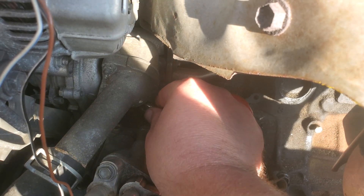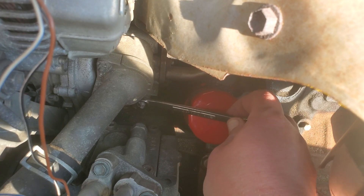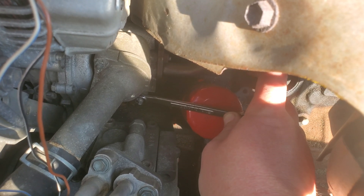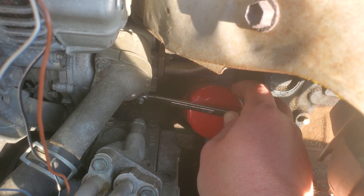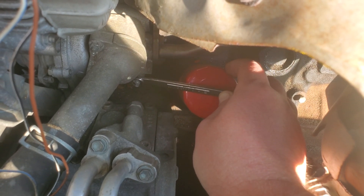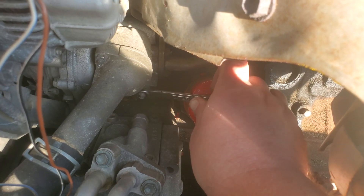The next step is to take a 10 millimeter box wrench — I've got one here from Craftsman, not a sponsor, but it gives me enough room to clear this way. Normally the book says you have to remove the oil filter here, but I don't really trust it at this angle, especially when I know it's probably going to leak oil everywhere and you'd have to change the oil just to get to the thermostat. Believing in the work smarter, not harder mantra.